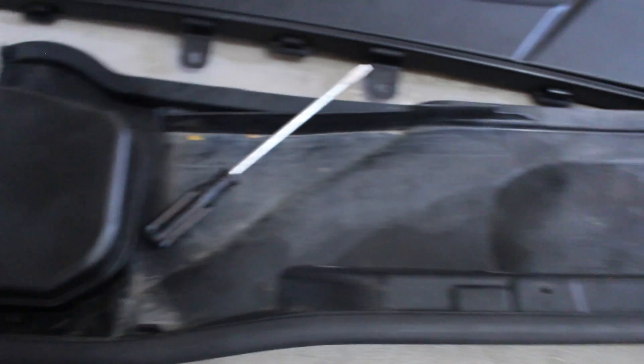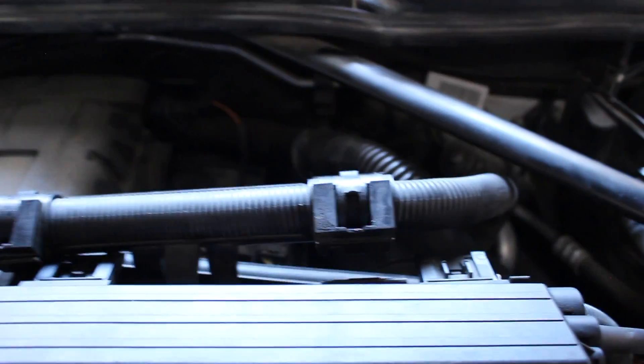With the engine cowl off — that's the thing that sits up there — you have six screws to remove, and then you get access to the area below. For my car it wasn't connected by any bolts, so it was a bit easier. There were some tubes running across the bottom — you just put a flat head in and pull them out, they come right out. The sensors you just clip out and they'll pop out. Now you have access to all this.